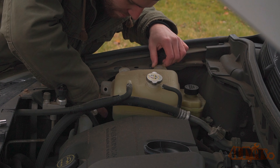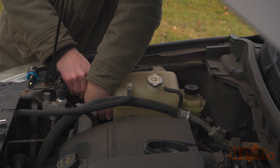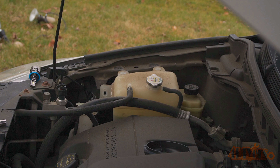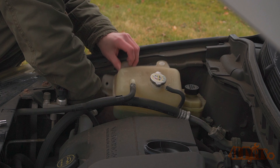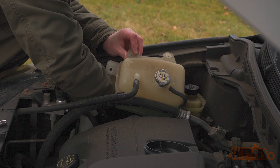The camera angles for this are quite limited, however I'll provide a better photo for the driver's side. Finally, installing the new replacement bulb — plug in the electrical connector. The bulbs are polarity sensitive, so test the bulbs before finalizing the installation. If it doesn't work, simply rotate the connector 180 degrees. When putting the bulb in the housing, you'll need to rotate the bulb and work by feel in order to find those alignment tabs, making sure they are properly in place. Push the bulb in, then rotate clockwise to lock it in.